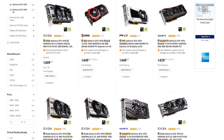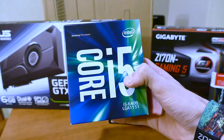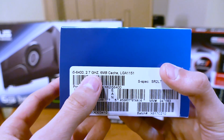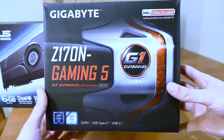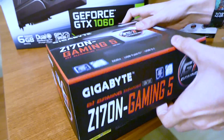Let's run through each part. First up, the Intel Core i5-6400. With four physical cores, six megabytes of L3 cache, and a frequency that we'll raise manually via the base clock method — more on that in another video — this CPU will be more than enough for modern gaming. In order to base clock overclock, we'll need a Z170 motherboard, and this one from Gigabyte is also in the ITX form factor we need.